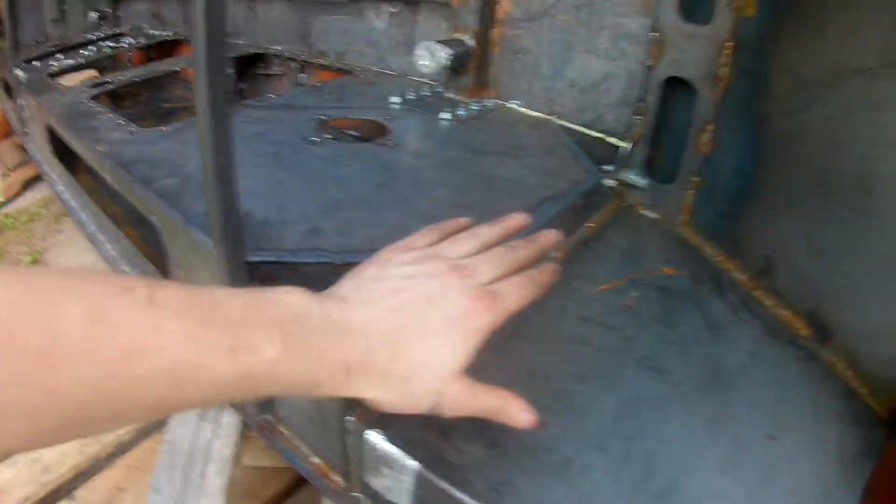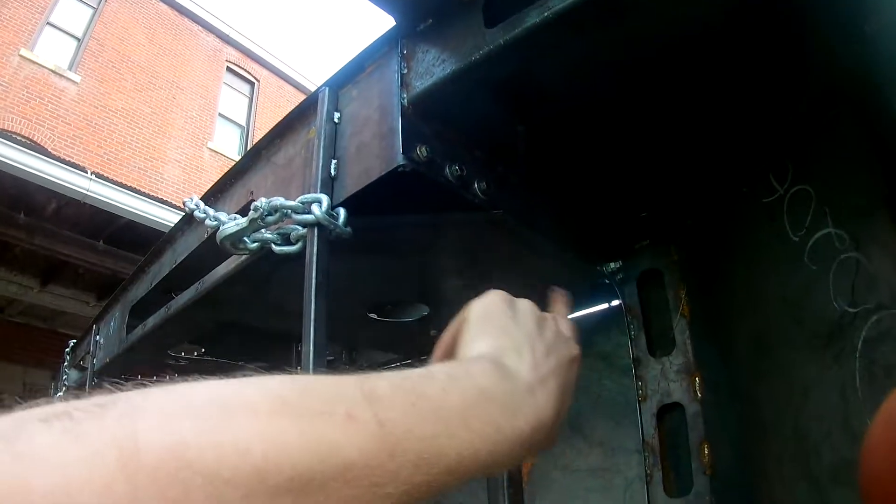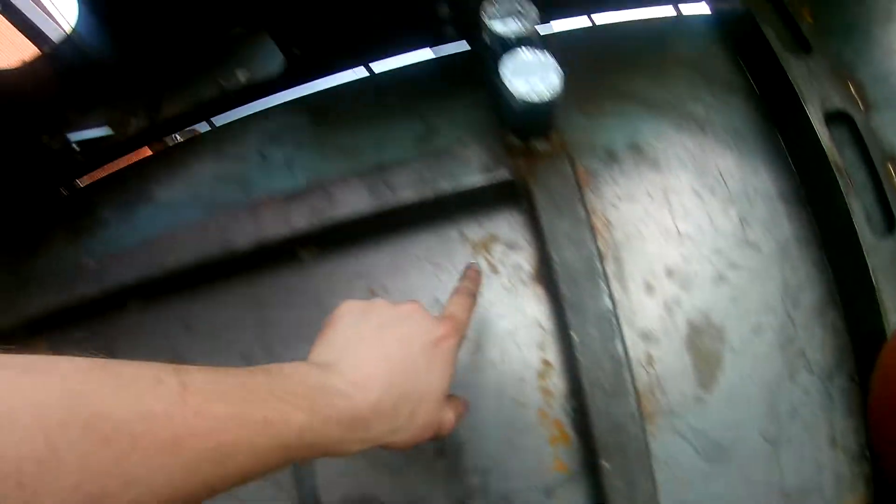You got your bolted interfaces on the front section — five bolts on this side, five bolts on that side. I got the belly plate done too. Essentially it's just a flat sheet with a skeleton of box section, so that will carry my exhaust gases to each wheel end, just like how the Sherp does it.